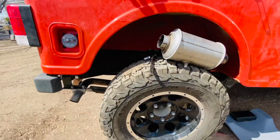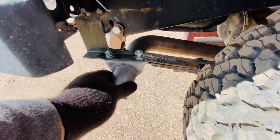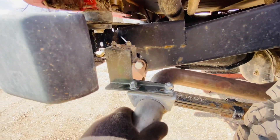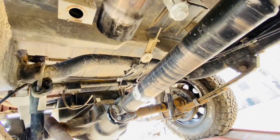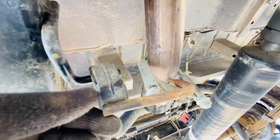To take these out, you just have to loosen these two nuts, get them to where everything can wiggle. There's a rubber bushing there, and then you also unbolt the C-clamps — slide this one forward, slide that one backwards. Take off the hanger right there, take off another hanger right here for the exhaust, and then you can move things around.